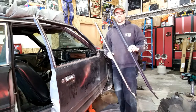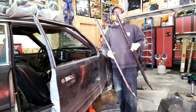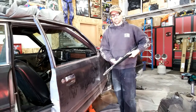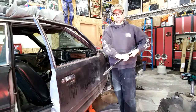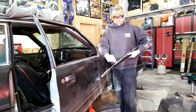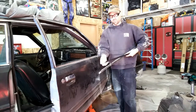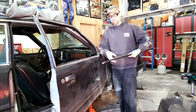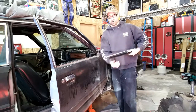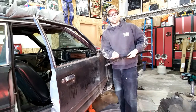When you buy replacements for these, they're going to come in black, and you may have had chrome from the factory. On the back side, you're going to flip them over — if you want to take the chrome off your original piece and put it on the new piece, so that you have a good rubber seal with good flocking on the back and the chrome on the outside. On the back side there are going to be tabs — folded-over ears that go through the seal and keep the two halves together. To replace them, fold up these ears on the new one so you can take off the outer piece, do the same thing on the chrome, and swap them back and forth.